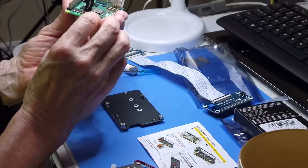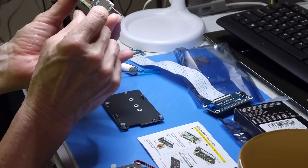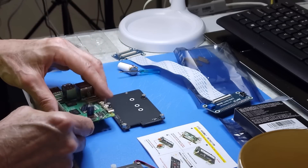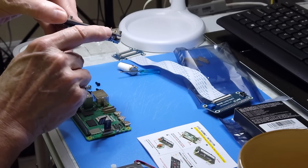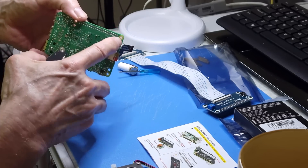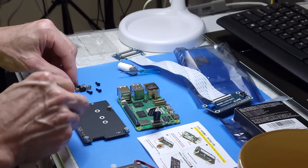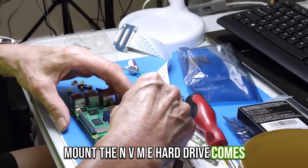Here I'm working on the flexible data cable that goes from the Raspberry Pi connector down to the NVMe hard drive PCB board — it's quite painful to get in. You want to make sure those flexible cables go in correctly, because if you get them in at an angle and lock it down, you'll cross-short the golden fingers. That could create a ground-to-power short or signal-to-signal contact, and it could be a real problem.